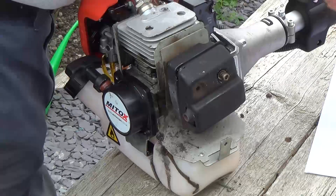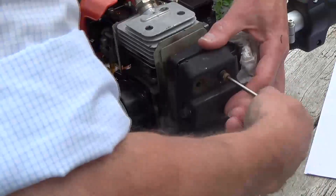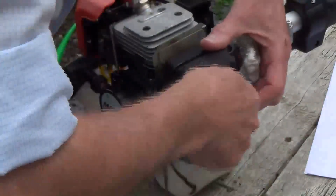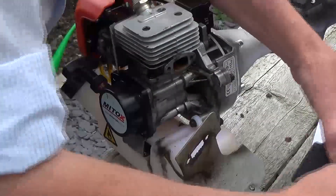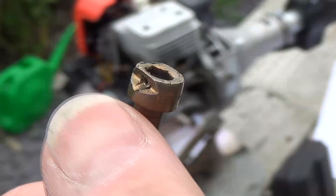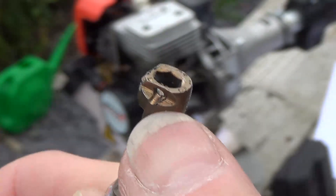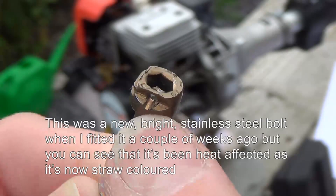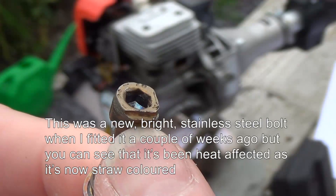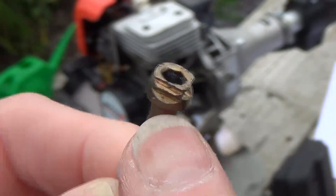So I replaced one of them with a stainless steel bolt. I thought, well I don't want these things dropping out again, so I did what they do on aircraft engines. I drilled a hole in the head of the bolt, put a wire through it, and locked the two bolts together. You arrange the wires so that it holds the bolt — as it wants to unscrew anti-clockwise, it would have to stretch the wire. I'll show you when I put this back in.